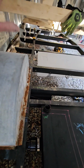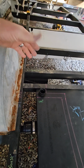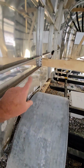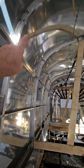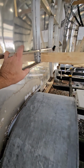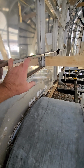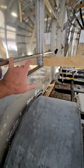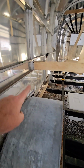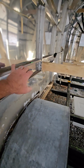There'll be a cabinet on this side of the shower. So on the outside of the shower wall, the vent for the gray will come up right next to it. And at this point, rather than venting through the top, adding another hole, I'm going to vent inside the cabinet with one of those, I don't know, there's a name for them, but it's an inline vent that you can use in residential plumbing, so I'm sure it'll work fine. And it essentially just allows airflow into the gray and out, and it's got a little cap on it. And since it's the gray, I'm not concerned about the smell or anything like that.